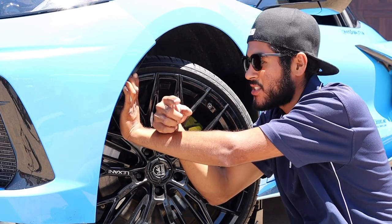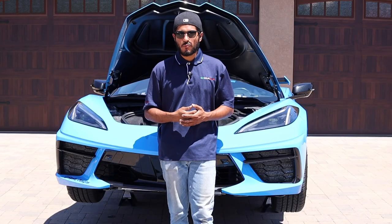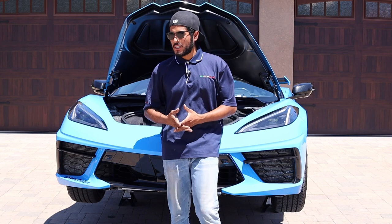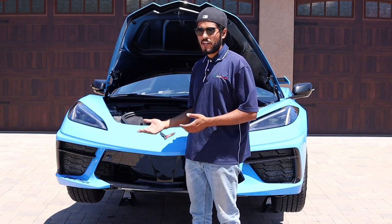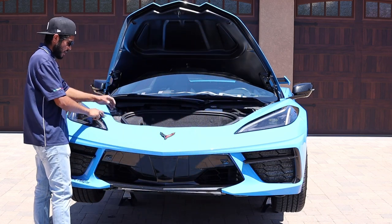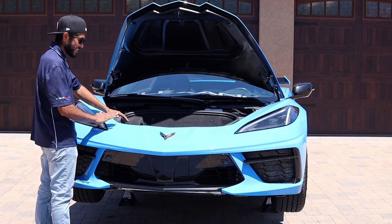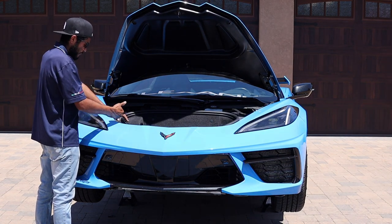On the other side you'll have one connector instead of two. Once you have both connectors disconnected, you're ready to start separating the four brackets that hold the bumper to the fender. Start with the upper part of the bumper — with both hands, kind of push down on the fender. Remember the fender is still bolted; it's the bumper you're pulling up and it'll pop out of place.